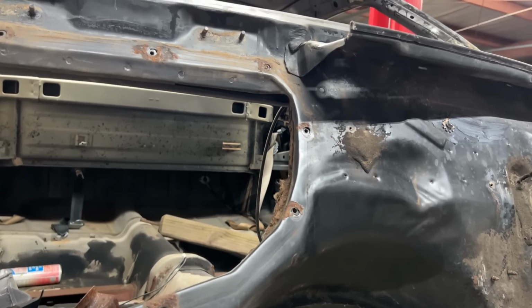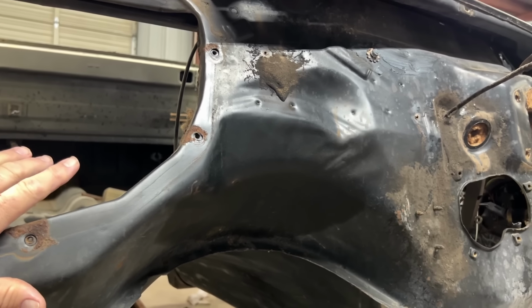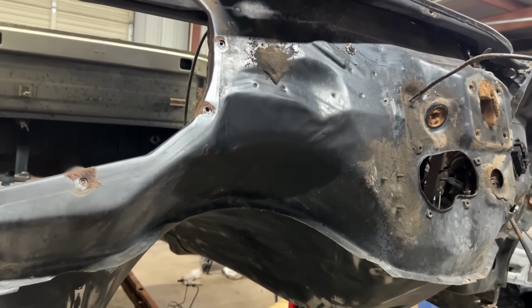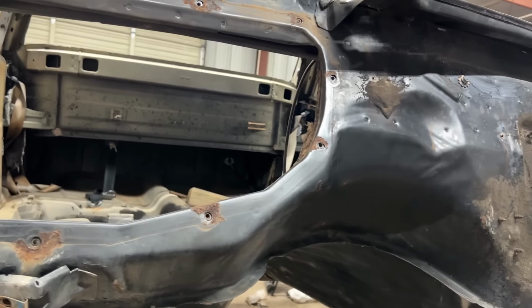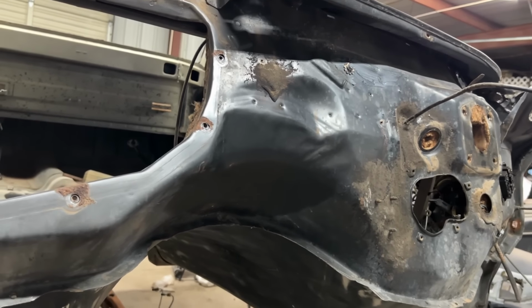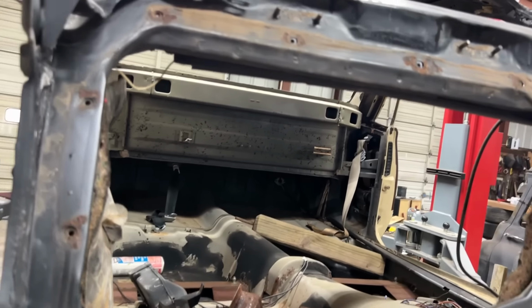And when I paint this, I'm going to be painting my motor block, the heads, the pan, and the timing chain cover. We're going to do it all in one shot. I'm going to mount it up on the block, spray it, take it apart. That way where the gaskets go, there is no paint. The only thing is I have got to really balance how I do this, because if I let it stay exposed too long, things are going to rust. So that's going to be fun.